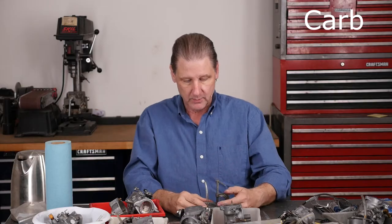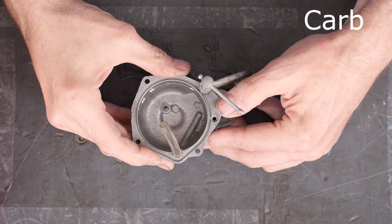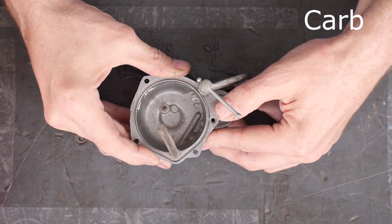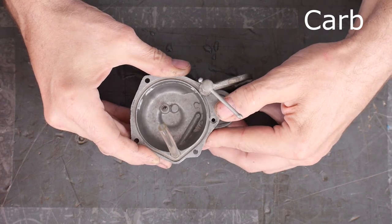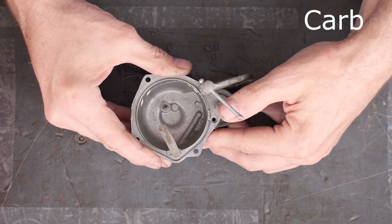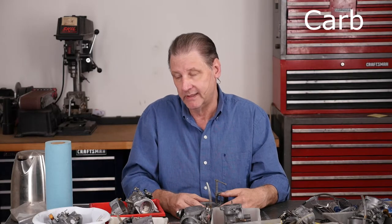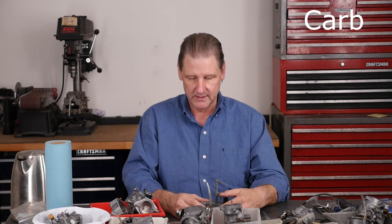So it's like having two outlets — a tiny one on the brass and the bleed hole in the bottom of the float bowl — and they could save the machining, the little check ball, and the little swedged-down ball on the end cap. Let's watch this one work: bubbles coming out that bleed hole. This one went up about a half inch above the brass on the second squirt, another half inch on the third and fourth. On the one I rebuilt yesterday it only took two squirts to fill the hose. It works — it's brilliant.